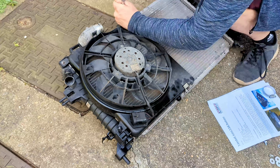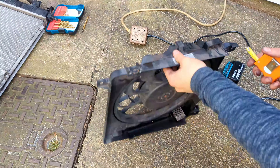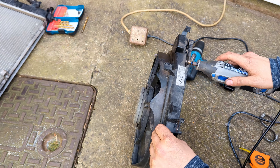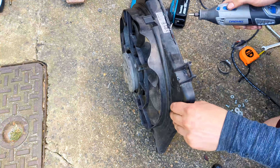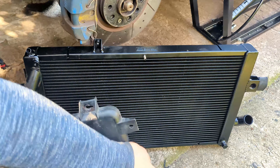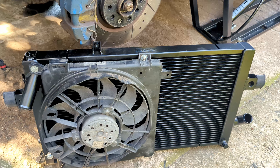I'll put oil and coolant in the car later when it's finally ready to start up again. But first I'm going to remove the fan off the factory radiator as I'm going to be reusing it on the Pro Alloy rad - simply because I don't need the extra cooling of expensive Spal fans. After drilling out a rounded bolt holding on the fan shroud, the fan shroud has to be trimmed flat using a grinding disc on the Dremel so it fits relatively flush against the Pro Alloy rad. You want to measure 12mm from the taller side of the fan shroud and cut along horizontal tapering off to the other side. The non-reinforced Dremel cutting discs are absolutely useless and I ended up using a hacksaw for part of it. After sanding down any rough edges, the fan shroud can be bolted to the radiator using the existing holes and the shiny new bolts that come with the radiator.